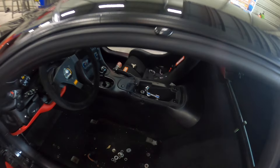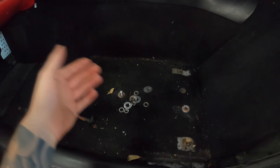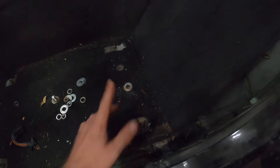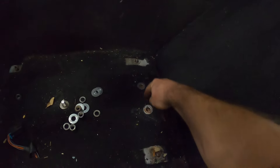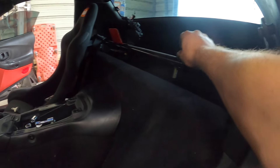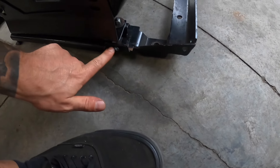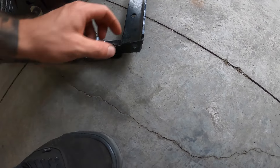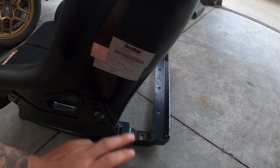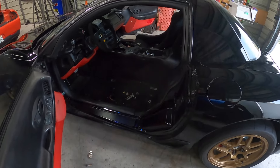If you're putting harnesses in your vehicle and don't already have mounting points, you will have to find places to mount them. I can show you where mine are mounted: the crotch strap is in the middle, and there are two holes drilled for the left and right lap belts, plus the mounting point on the harness bar. The seat bracket also has holes which could potentially be used. Also note the FIA certification on these harnesses — they're good until 2027.